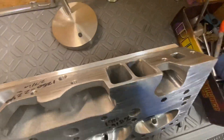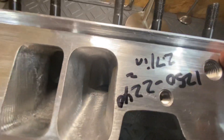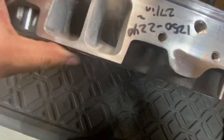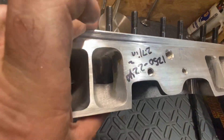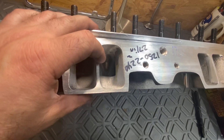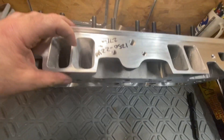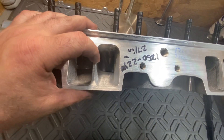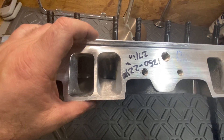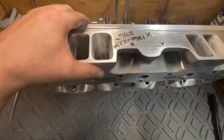You can see here there's a shot of the port window with the holes exposed. Right now I've broken through — I pushed it as far as I could push it. This'll get welded after it's digitized, you'll never know it. Right now the push rod pinch is 1.250 by 2.240 minus the corner radius — it's about 2.7 square inches. That's really pretty good.